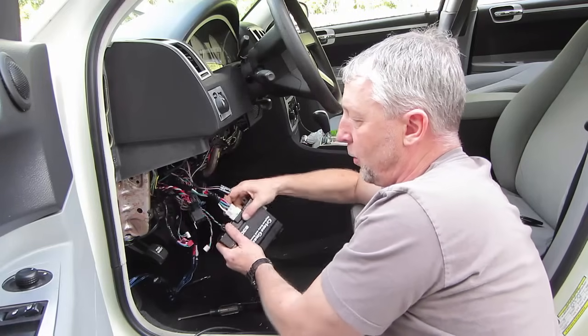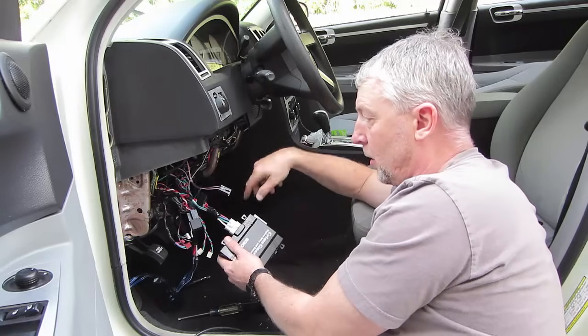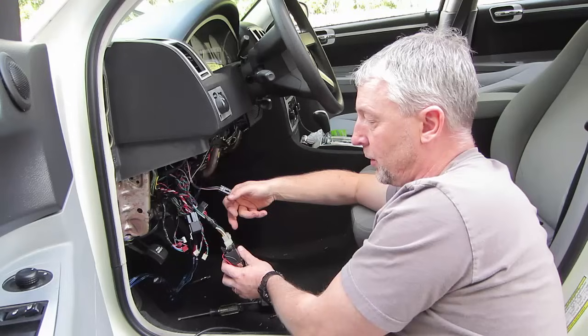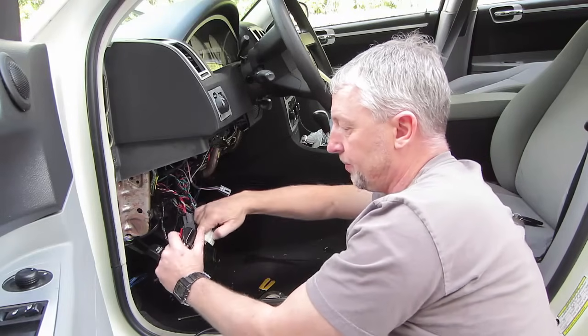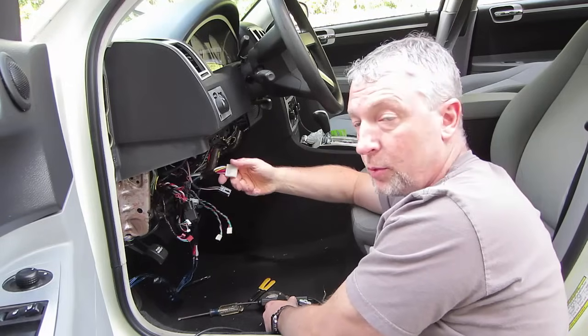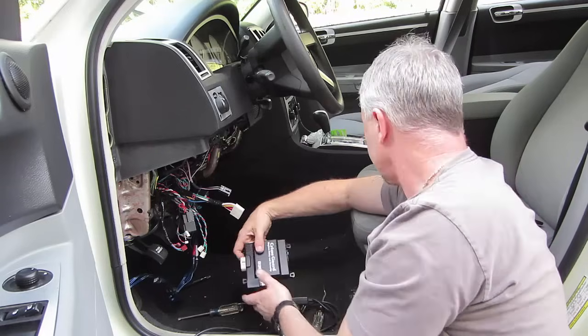And here, the one with the fat ignition wires, or power harnesses, this here is your primary harness for the alarm's power: constant, ignition 1, ignition 2, accessory, and starter output. It's typically what you find in these. It'll either be a 6 or an 8-pin harness. In this case, this one here is an 8-pin. So there's your main alarm system disconnected.